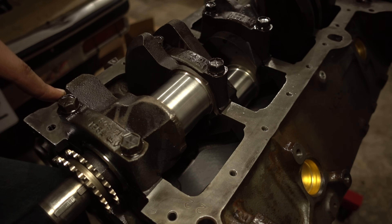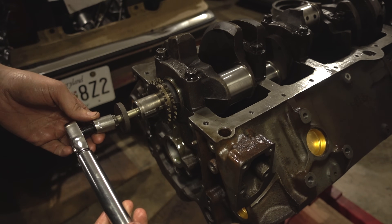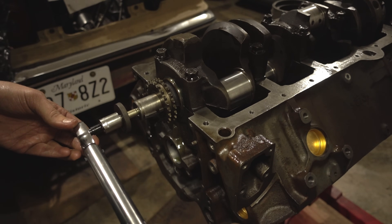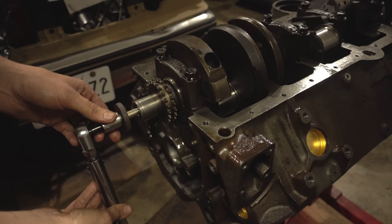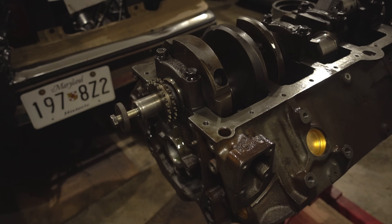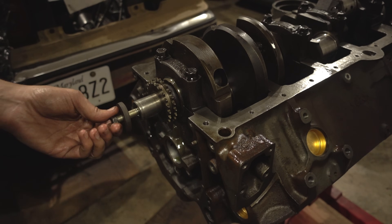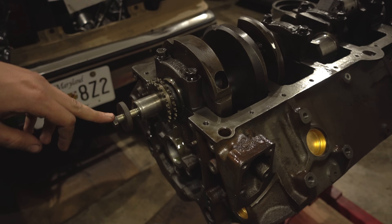This assembly lube is so tacky you can see the crankshaft will actually keep moving once you stop turning it — it's springing back. It's a good idea to check crankshaft rotation as you go through the process of finishing up the short block. Right now it takes under 20 inch-pounds to turn this thing, so going good so far. With these high clearances I don't imagine any of this would be a problem, but it's a very good idea to do this repeatedly as you put new pieces in so that if something does go wrong, you can catch it early.